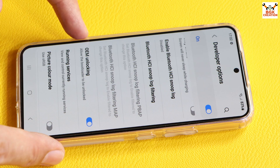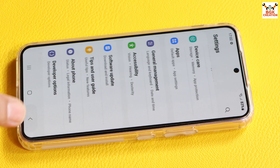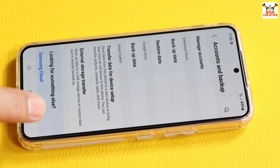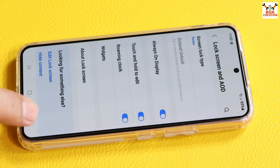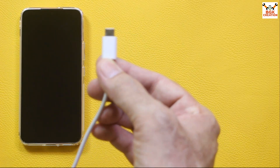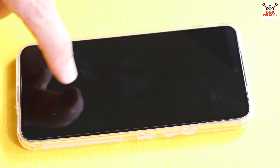Go back to Settings, go to Developer Options again — OEM Unlocking is now accessible. Turn it on, because we need OEM Unlocking enabled to unlock the bootloader; this will also allow the KG State to become 'Checking.' Then go back to Accounts and Backup: if you have a Samsung account, sync it and remove it. If you have a Google account, sync it and remove it to avoid issues. Go back to Lock Screen and turn off the screen lock by selecting Swipe.